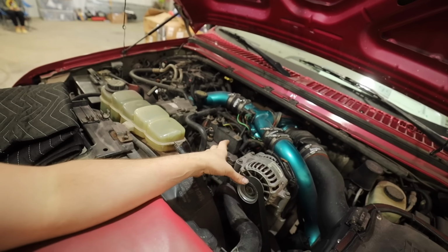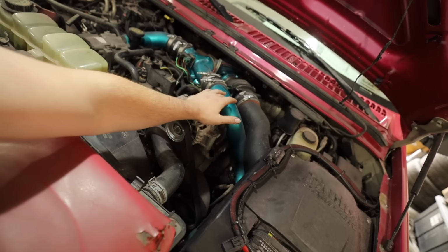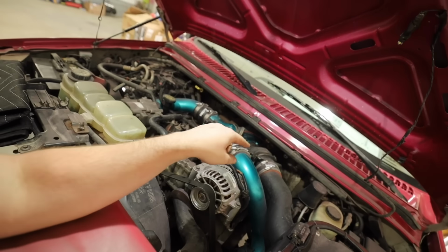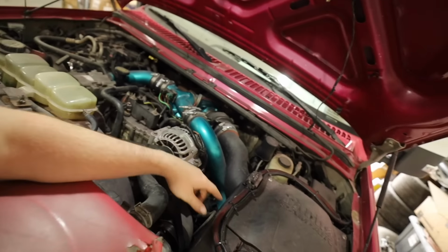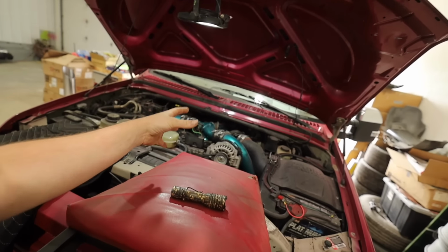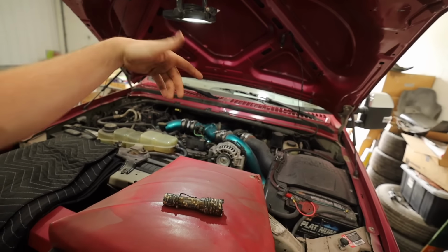which is absolutely fine because we have added a lot of air, literally like a big, gigantic intercooler, big boost tubes, upgraded the turbo, bigger exhaust housing, letting all this flow, cold air intake. We did add probably as much air as you can without actually changing the whole turbo to a bigger size, not just upgrading the wheel. So we've added as much air as possible until we start getting into the turbos and stuff.